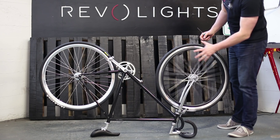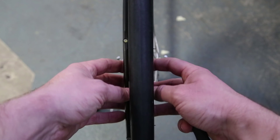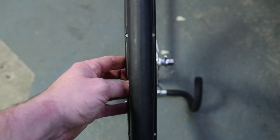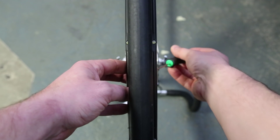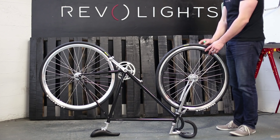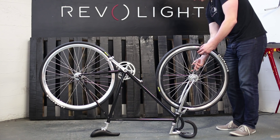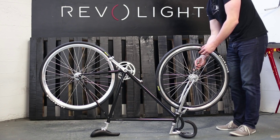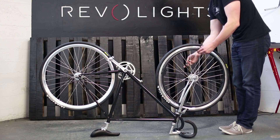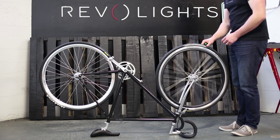Give it a quick spin to see how straight the rings are. It looks like it wobbles a little concentrically and quite a bit left to right, so let's start with left to right. What you want is — looking end-on at the tire — to see both LEDs when they're facing you, so the light can shine past the tire. That looks pretty good, so I'll tighten down these first two screws, note how much visibility I have, then go to the next mounting point and adjust that to be the same. Go ahead and do the remainder the same way.